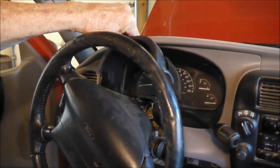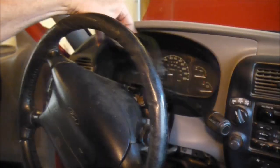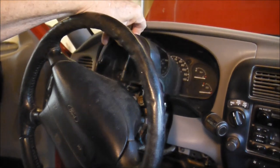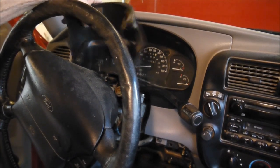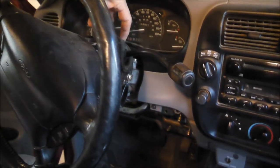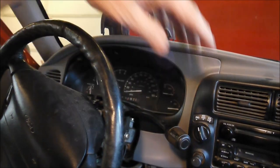The top part of the steering column cover comes out with some difficulty. You have to screw the tilt mechanism lever back in, push the wheel down, and then wiggle it around. The boot stays here for now. Be careful you don't break any of these tabs off, otherwise you'll be in more trouble.